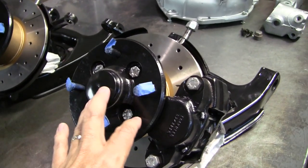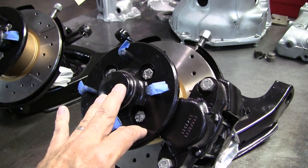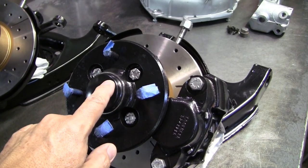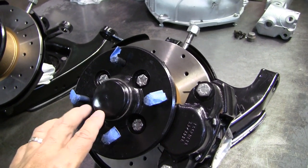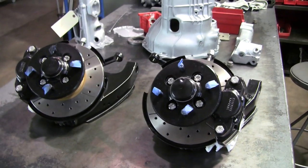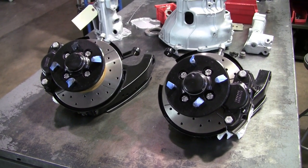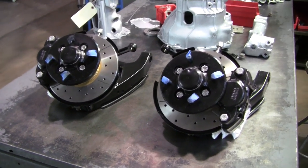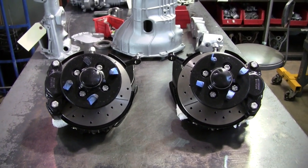The torque setting for your nut inside is again 40 foot-pounds, then take your castellated nut forward — not backward — to the next hole, put your cotter pin through, bend it, and put your grease cap on. If you have any questions, my email and phone number are in the description. If you like the video, give it a like and subscribe — we'll keep helping you with these videos. You can add suggestions in the comments, and we'll see you at the next one.